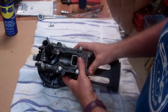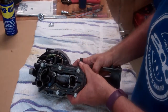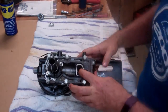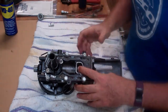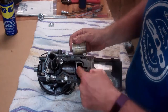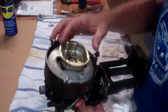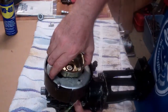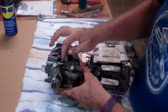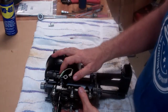So how did I get this unseized and freely turning? It was seized in three different places from the saltwater sitting. One, it was frozen at the piston — the side was frozen to the cylinder. Second, the flywheel was frozen to the contact up here. Third, it was seized in the ball bearings top and bottom, more the bottom than the top.